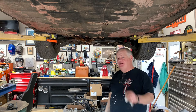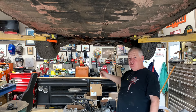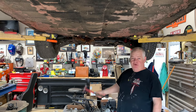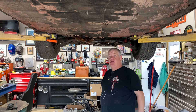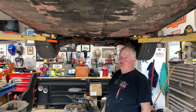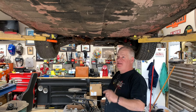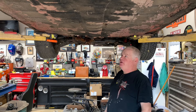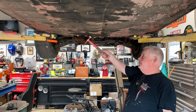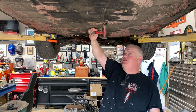I could not drive the car with pedals hanging out from underneath it. The front suspension pan that all the suspension is bolted to — I cannot drive this car with the suspension bolted to rubber undercoating in the front. It would be non-steerable, non-stoppable. Parts like the master cylinder, if it worked, I could still be driving the car and fixed it when it quit working. Cleaning up the suspension and underneath the car — I could do that after it was already running and driving. But these rust repairs, might as well go on and get them done.